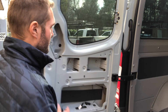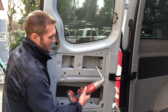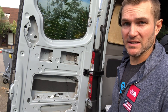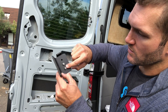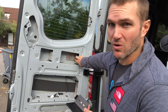Okay, so you've got the panel removed. You're going to go inside the door. We're going to use that hole in the door to mount the rack — it's a 13 millimeter. I've already got a plate installed on this van. This is an unpainted plate, but yours will be a powder coated plate. Now you've got three holes here — that's because this plate is ambidextrous, it can be used on either door. So you're really only going to use the bottom two holes.